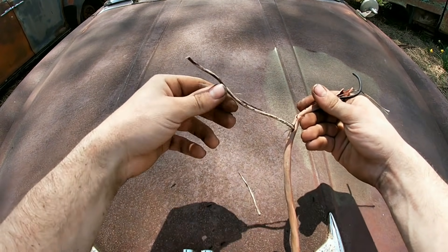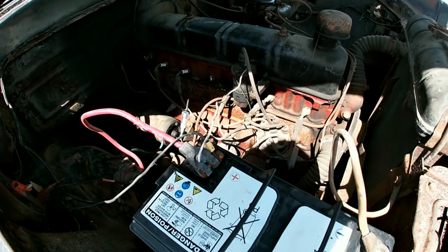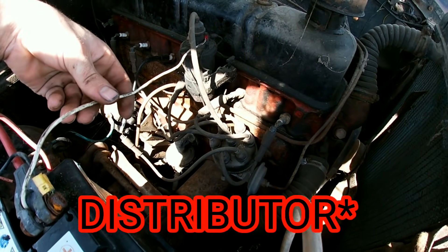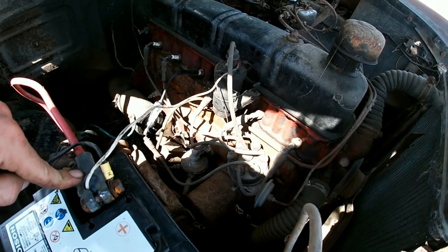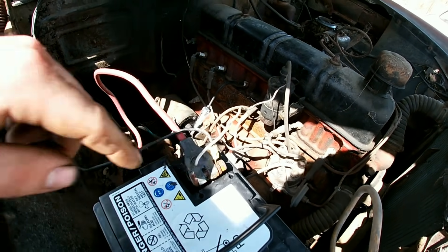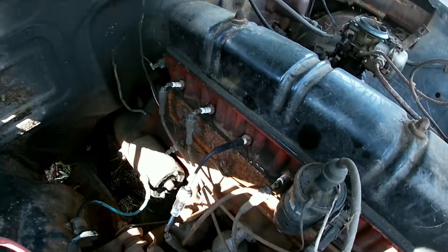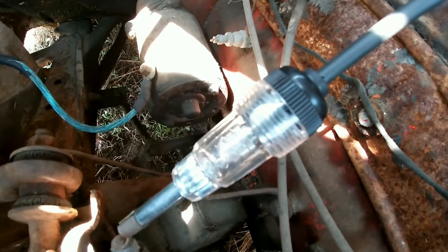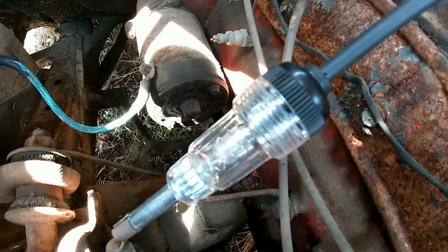As you can tell, you've got as much wire as you'll need — just cut off what you need. To get fire to the spark plugs without a key, we're gonna run a wire from the positive on the coil, which runs to the key switch, straight to the positive on the battery. I've got my spark plug tester hooked up, so hopefully y'all can see if we're getting spark.